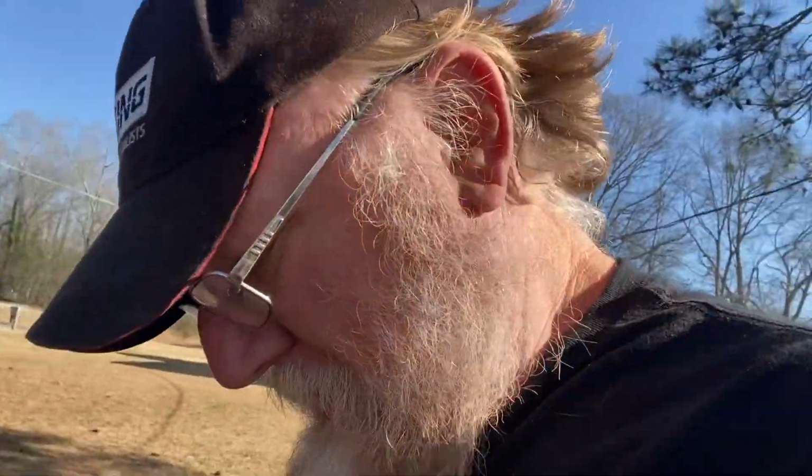But my thought pattern is, and I know everybody's going to have different thoughts on this, but my thought is it would have had to have actually ran a few minutes for it to go through there and scar everything up. What I'm saying is it would not have just started up with low oil pressure. It would have had oil pressure and then kind of gradually went away, if you understand what I'm saying.